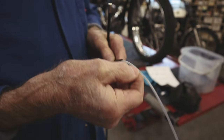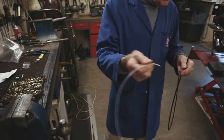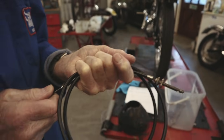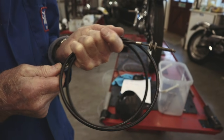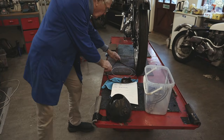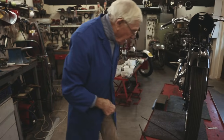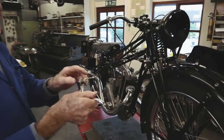You put the wire through the outside and that means it's very smooth operating. If you get an old cable and you wind it round there it's devil's own job because it's steel against steel. But when you put that on with the nylon liner and wrap it round like that it's as smooth as silk — makes the clutch operation and front brakes much better.